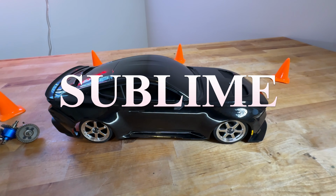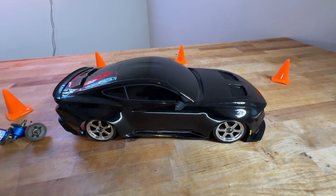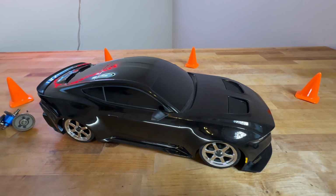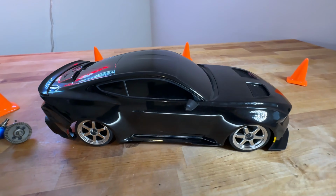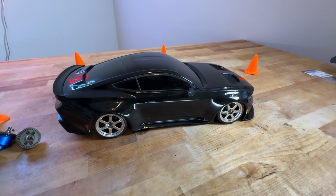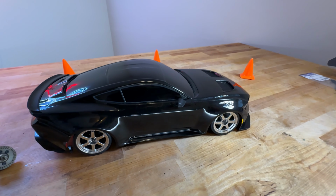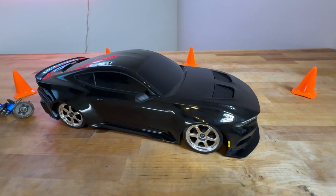It's just that good. Now, because you're outside and you're using the hard rubber tires and wheels, the best settings for the camber, which are very important, are negative 4 or 5 in the back, and negative 4 or 5 in the front. You're going to have to do it to your taste level. You want this thing skating outside. You want to really crank up that camber because it's hard rubber. It grabs more than a plastic wheel, so you don't want to have any grabbing. You want it just skating, like an ice skate rink. And after all these upgrades, I would say the stage 2 upgrade takes the car to its last and final level, and it'll drive like a $700 drift car, in my opinion, and that is what I recommend.